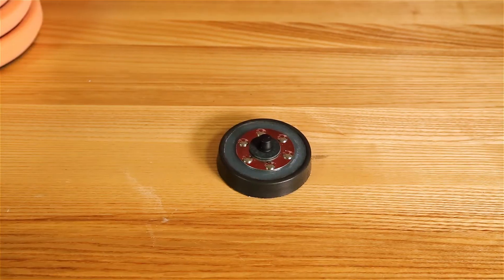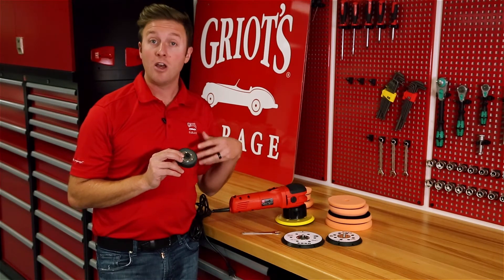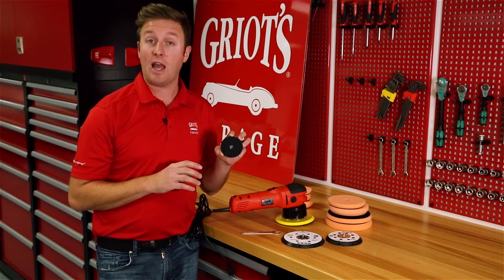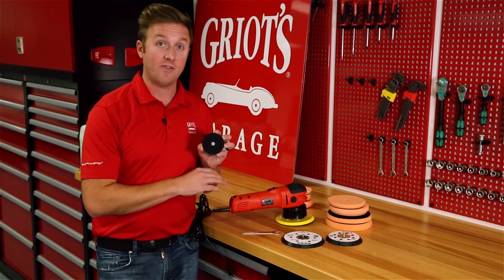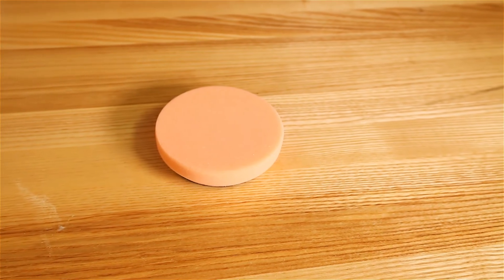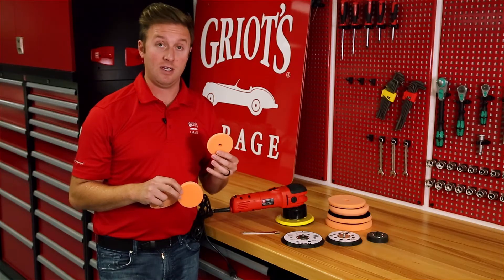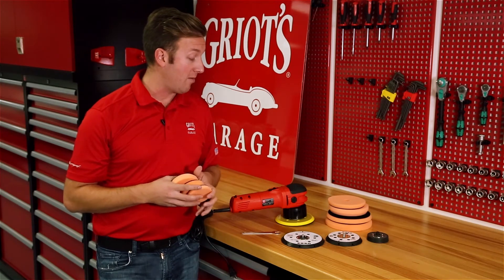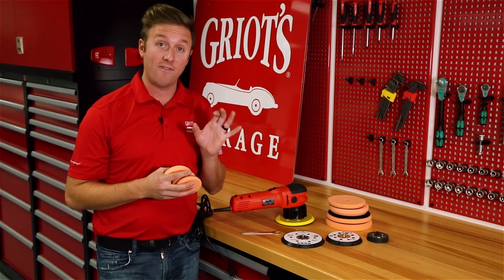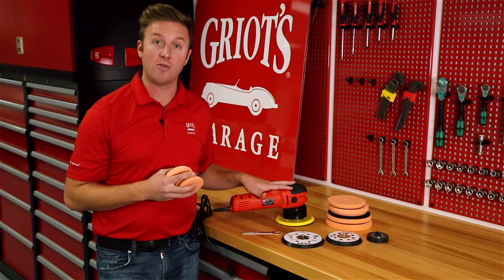Lastly, we have a three inch backing plate. Now this thing is unique because it is weighted the exact same as our two larger backing plates, so that doesn't equate to any more vibration than you're going to get from the machine. But with that incredibly small diameter and surface area, you're going to have a very aggressive result from the power source of this six inch machine. It can accommodate the full gamut of those smaller pads — we have a four inch one inch thick pad, a three inch one inch thick pad, and our boss line of three inch five eighths inch pads. Any combination of these on a three inch backing plate and this powerful six inch random orbital is going to get you an incredibly aggressive result and also get you a very tight footprint to do hard to correct tight spaces on your car with a very powerful motor behind it.